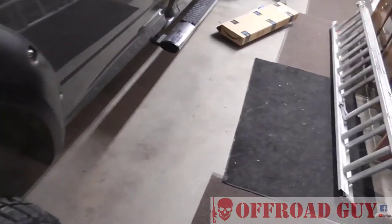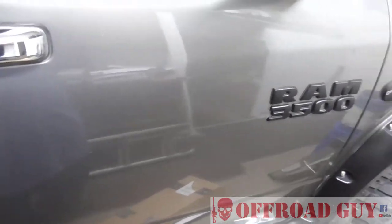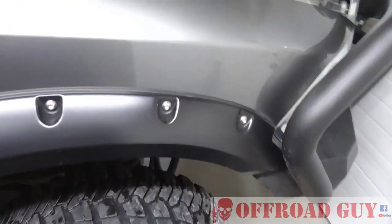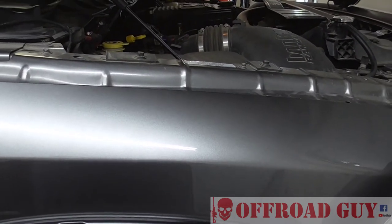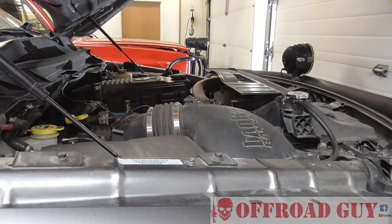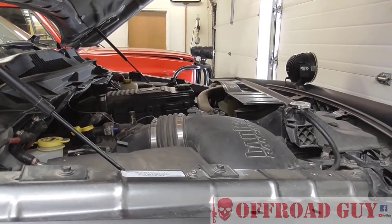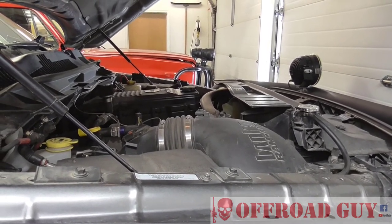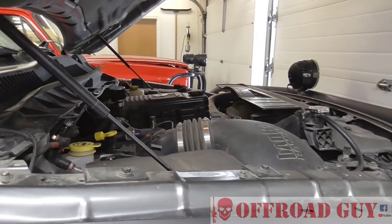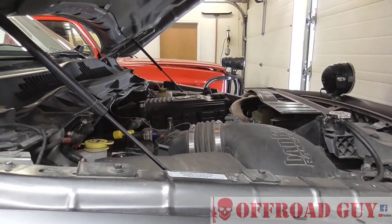Each setup is a little different. This one on the Dodge definitely cost me a lot more. The electric setup is clean, but the engine-driven one on the Blazer is higher performance and cheaper since you can get a lot of the parts at the junkyard. I paid about $40-50 for the compressor — this was about 15 years ago — and $35 for the air tank. With all the fittings I probably have somewhere around $200-300 into the whole Blazer compressor setup. That compressor puts out a lot of air — if you rev it up you can even run a die grinder, which is pretty impressive.